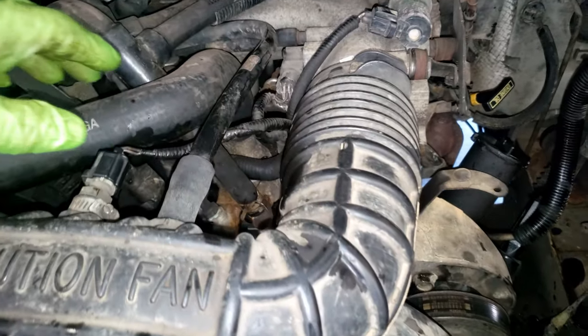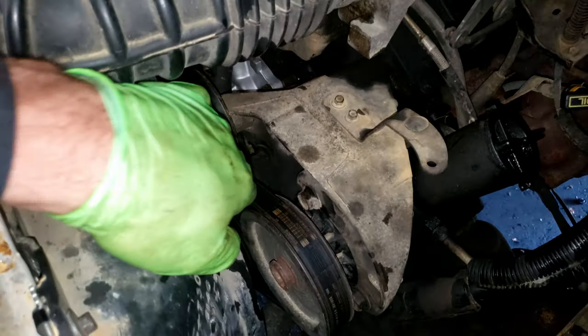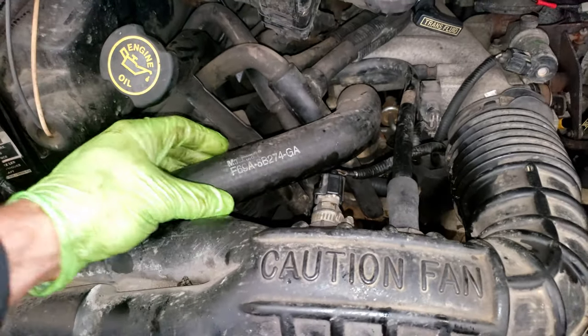Speaking of other things that should be done on this job, it wouldn't be a bad idea to replace your thermostat. If your fan clutch is bad — this one actually has a newer fan clutch, but if you spin it and the fan spins really freely or it's locked up, replace that fan clutch. And of course your serpentine belt and anything else that looks like it needs attention. Like your radiator hoses — these are original but they seem in good shape. If they're bulging, soft, or dry-rotted, make sure to replace them. Make sure to drop this a thumbs up, comment, any questions leave them down below, check out the links in the description. Consider checking out another video on my channel or subscribing. Until next time, this is Chris Brown — no-nonsense know-how — and I do hope I see you again.